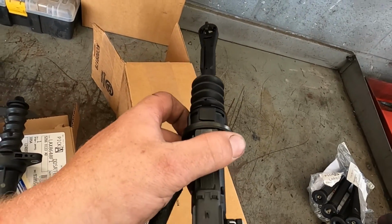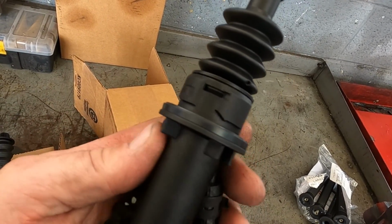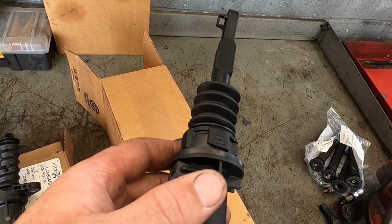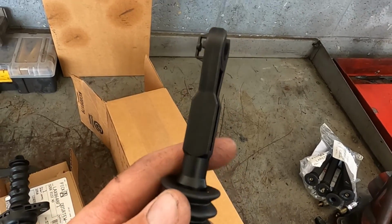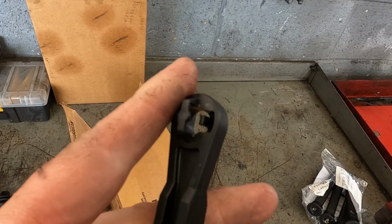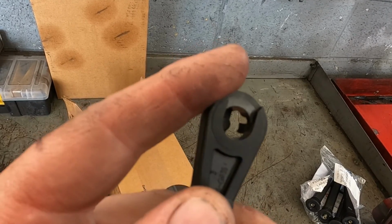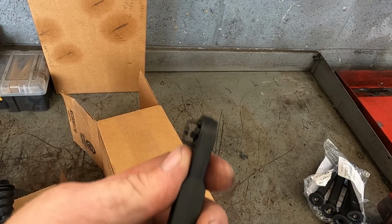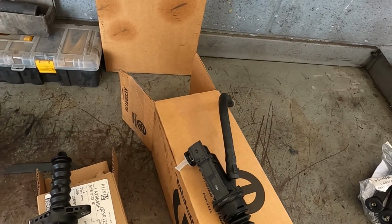And then the master cylinder, I'm definitely not going to film because these are a push lock design. So you push in to lock them in, and I don't really want to film myself swearing non-stop. The only other thing you gotta watch for, and again, this is going under the car, which I probably won't film, is unpinning this little eyelet against the clutch pedal rod. Now it's just going to be a pull, so you just get a tool or a wedge to pop it off the other side, and it comes right out. So I'll get to installing these, and then we'll bleed the clutch system and test to see if the clutch disc is okay.